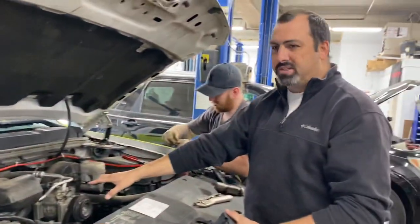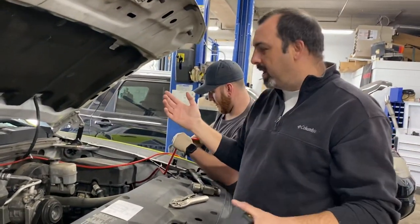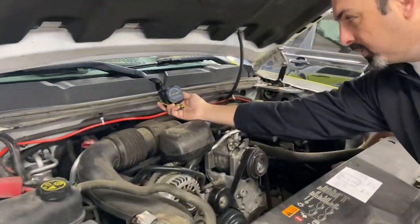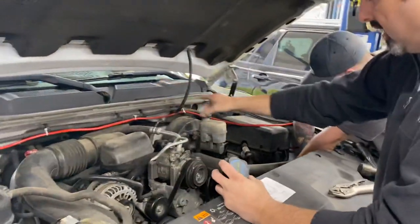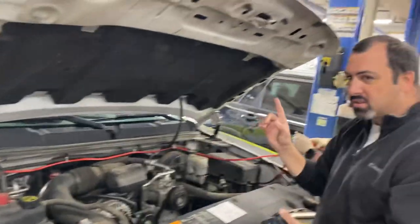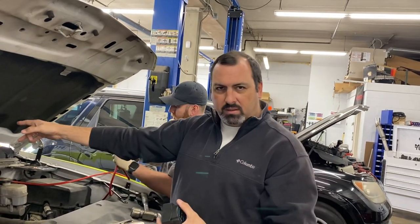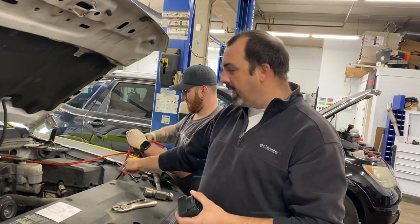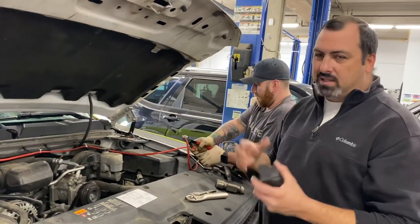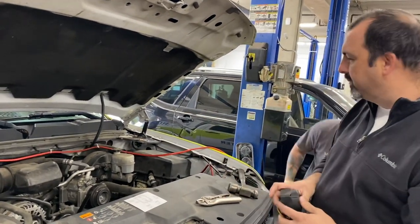The reason is, if I have the engine off and I've discharged all the energy from both batteries, I'm going to be dead in the field. So what we're going to do is isolate that battery by putting this little bad boy right in the middle. If this one's discharging, it will not allow it to discharge from this battery. I can also use a switch — and that's what these two lines are for. You can put a little kickover switch and allow the energy to flow from this battery, if it's charged, back to the main cranking battery if the main cranking battery is dead. So that's a dead kill switch — and it gives you that energy to go back, which is really, really neat.